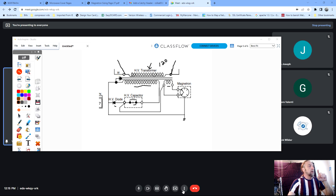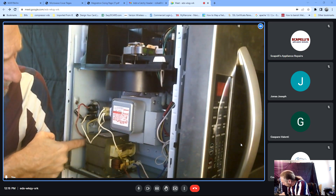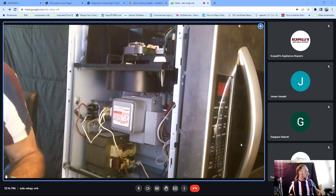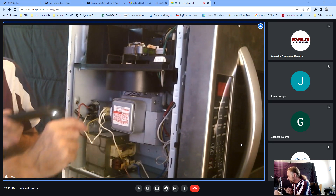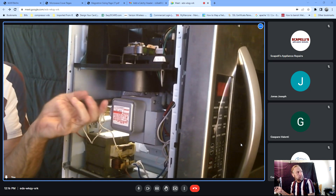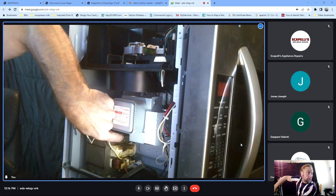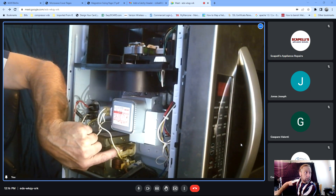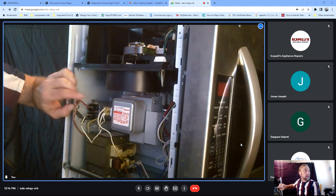This little red wire goes to the top winding on the transformer. There's a rivet right on that transformer - that rivet is the other side of the high voltage right there. If I wanted to check the high voltage winding for ohms, I would go from that rivet to this red wire. The low voltage goes - they're a different color, but sometimes they put in the same color. If you look underneath the transformer, you're going to see a wire.